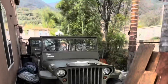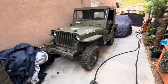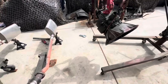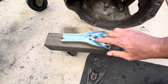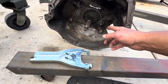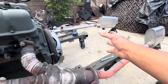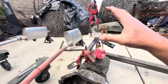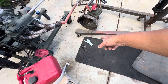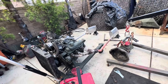I know it works because I've got them in both of these Jeeps. This one's been running about 15 years and the other one has been around since 2021. It works in all the other Jeeps I've built too. This is a brand new one — you can see how it doesn't grab all the way onto the ball. It's a real hard time trying to get it in there, and if you do get it in, you'll struggle for hours. Finally you might get it in and by the time you do it'll fall right back out — back and forth, very frustrating. I'm going to cut that fork up, turn it around, insert the throwout bearing, and slap it together.